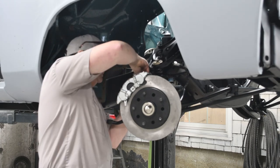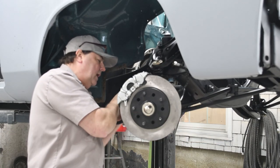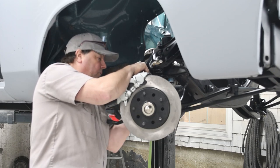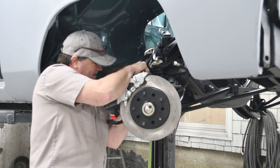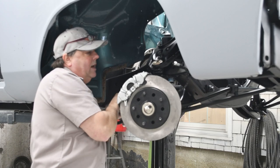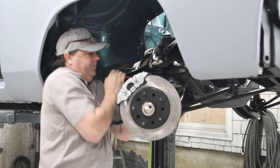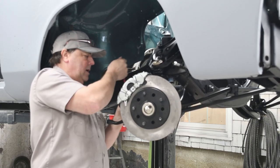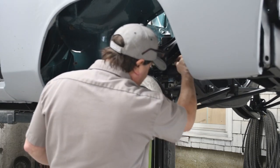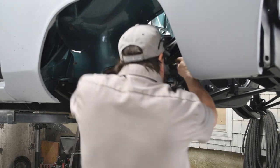You want to make sure with your bolts that you screw them in by hand, getting them started and screwing in as far as you can before you start really wrenching on them — because you don't want one bolt to cause a bind for the other. Having an Allen wrench with a ball head kind of helps, gives you some angle; you can also get them on a socket, whatever works for you. I'm going to snug these up — not crazy tight but fairly tight. And then I'll take my horseshoe clip and put it on here to hold my brake line in place.